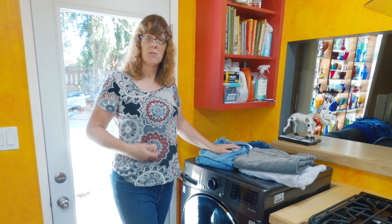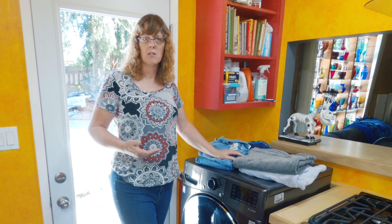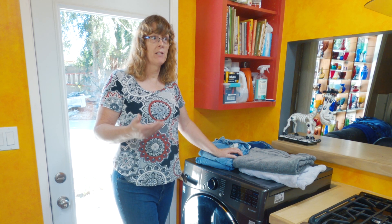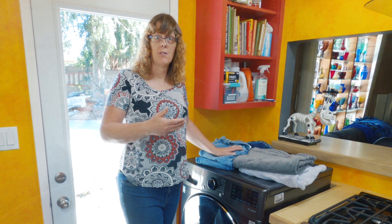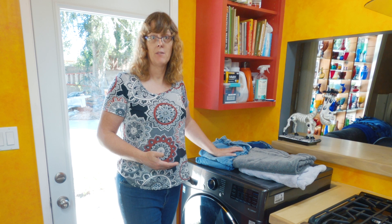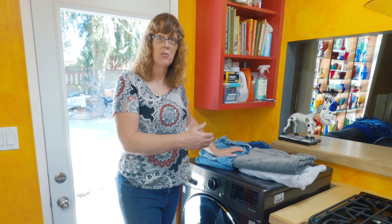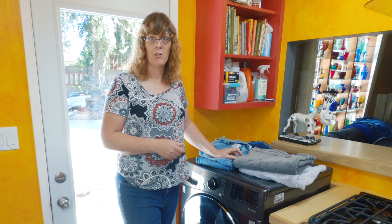I don't experience a lot of wrinkling issues with t-shirts, permanent press items, jeans, or towels. I do see it a little with sheets, but sheets get folded and put away and then stretched out, so wrinkles on sheets aren't a big issue. If you are washing and then choosing the timed dry cycle, 90 minutes is a good starting point for a half to two-thirds load of standard cotton clothing. I'd recommend allowing it to do that 90-minute dry plus the 25-minute spin, as that spin cycle extracts water before the dryer cycle kicks in, giving you a better chance of getting clothes dry.